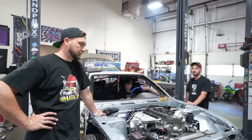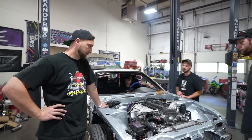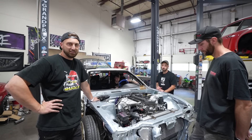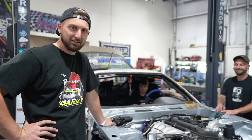The car running doesn't mean it's almost done — there's still a lot to do. Next up is to get Brian on his first little test drive. The boost control is all wired up and mounted. A CAN system harness was made so the CAN lambda and CAN gauge all plug in. A bung still needs to be welded in for the wideband lambda. A fan controller also needs to be wired. After that, it should be hooked up enough to drive. Link Monsoon kicks ass, KAT coming soon.